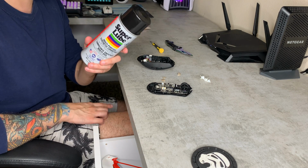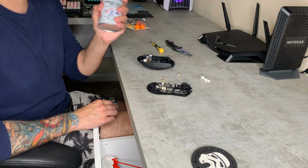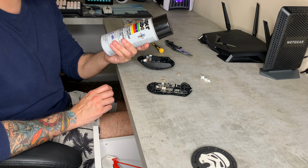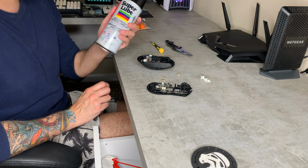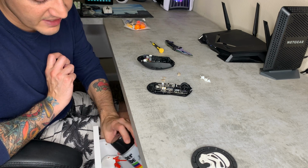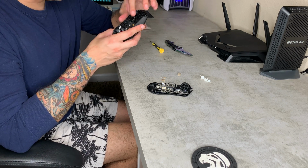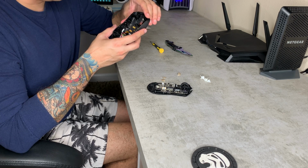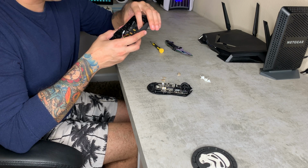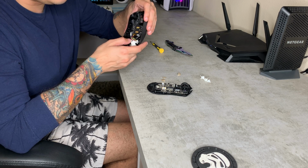If you guys missed the tutorial of me spray lubing my Razer mechanical green switches in my keyboard, my Black Widow Elite, this is the lubricant that we used for that. I will have this linked in the description below as well. You can use something like this, or if you want, you can use an actual thick grease on there. You just want to make sure that it's safe for silicone components, and you'll have no issues whatsoever, and that will cut down on that squeak, which I haven't had that issue, but I know many people do.